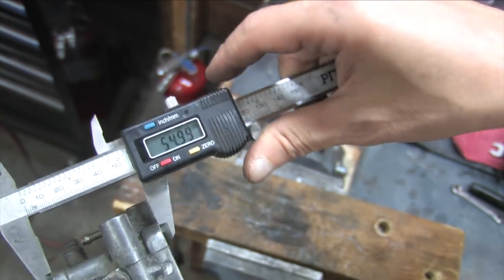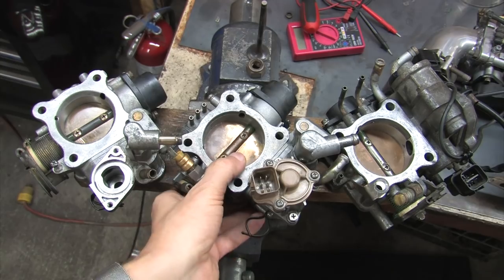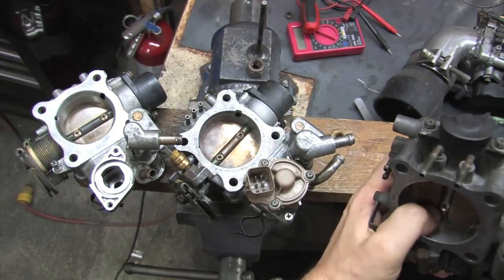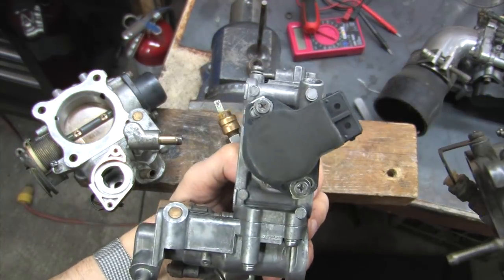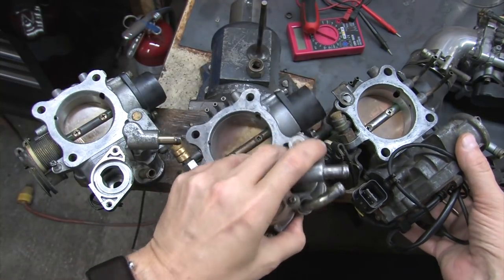If you have a 2G throttle body and you want an upgrade, the best option for you is really the 91-94. Forget about using the 90. It's a wiring and a plumbing nightmare for you. It has parts that are hard to source should you ever need to rebuild it, and the TPS sensors cost 6 times what you can get the 91-99 sensors for, even from online parts stores. And that's only if you can find them.